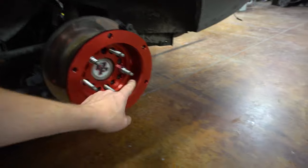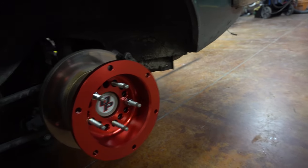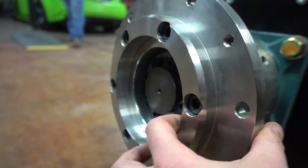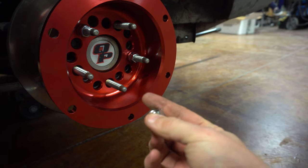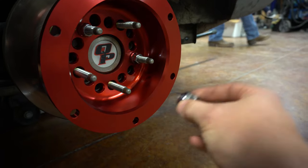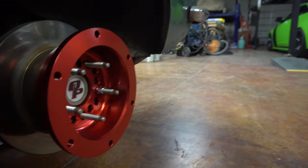So I grabbed one of the hubs, put it on here, and kind of measured right here. Hopefully it clears this lip — if not, these will be too long. But as long as it clears, it'll be real close. Might get lucky and they'll actually sit just to the inside of that, so you gain just that extra room. These have the 60-degree nut on them — this is what we use on the Mazda. On some race cars you don't have this type of nut, but this is how they're designed because a lot of factory vehicles use these. It helps center the hub onto the wheel.